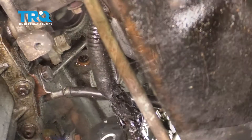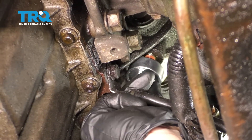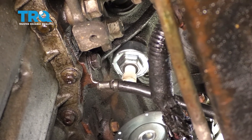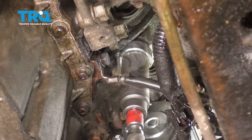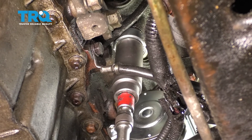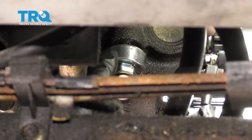There it is. Now it's time to install our brand new knock sensor. Carefully put this up into position — we're going to start it in by hand to make sure we're not going to cross-thread it into the engine. Now that I've got a few good threads in there, I'm going to snug this up only approximately halfway to three quarters of the threads. I can feel it starting to get a little more firm to turn, so I'll give it just a teeny bit more. Take a quick peek to make sure I went up as far as needed — from the front here it looks perfect.